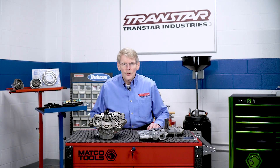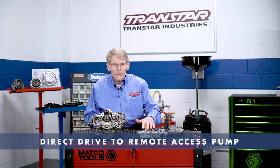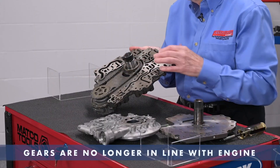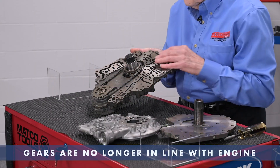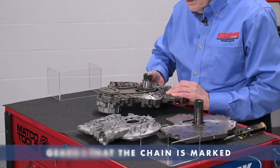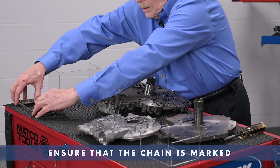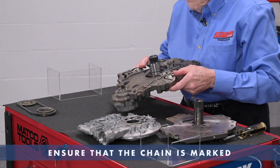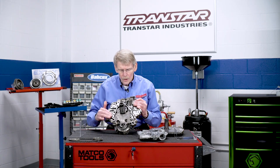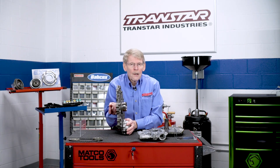Due to fuel economy concerns in 2013, General Motors decided to make a change. They went from a direct drive pump to a remote access pump. Instead of the pump gears being in line with the engine, it is now moved off center and is driven by a drive and driven gear and a chain. When you take these apart, always make sure that the chain is marked to properly reassemble it. This is a stator support just like on the Gen 1 and 2. It also has valves that must be addressed. This is actually the pump body, which is much more compact than the direct drive design.